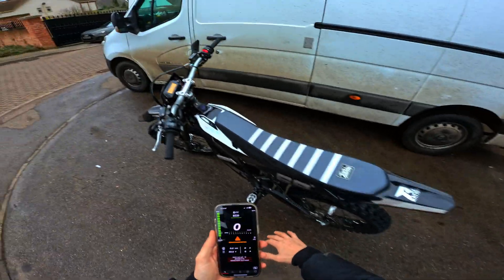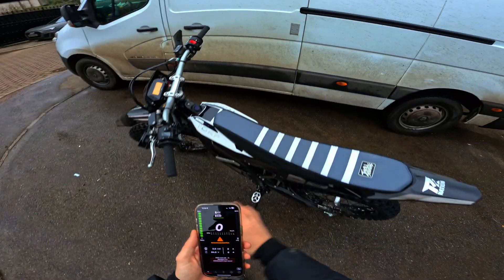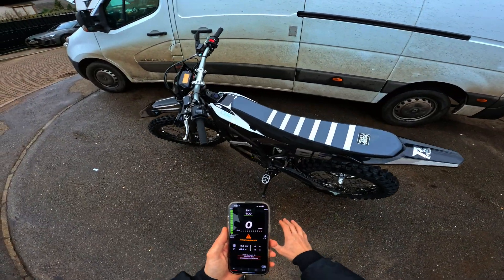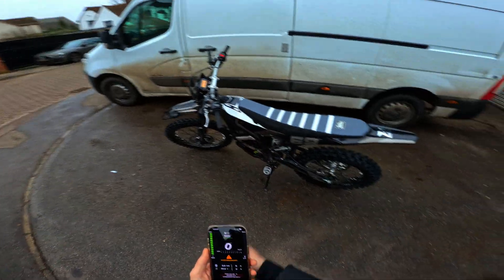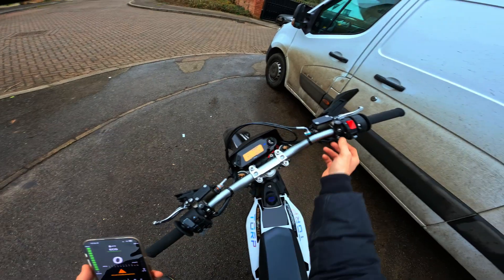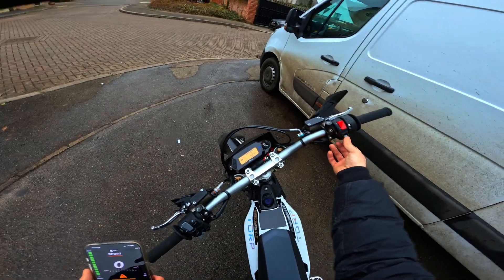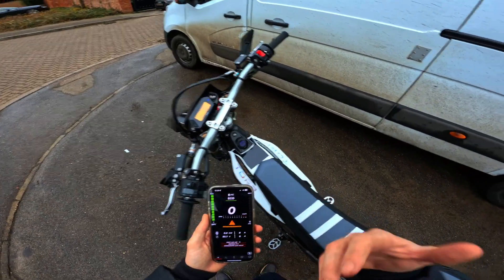Eco and daily I'm going to leave the same. When you initially boot it up, it just asks you to go through the calibration process — you lift the wheel off the floor, it will spin backwards and forwards a few times, then it asks you to full throttle and let off, and that is it. The controller keeps the sensors for your kickstand and brake lever still functioning, which is one of my favorite parts. It also keeps your standard display and standard switchgear for all your modes.